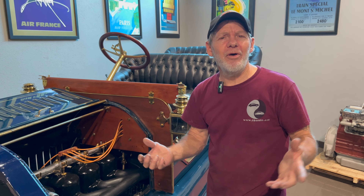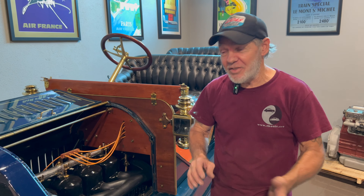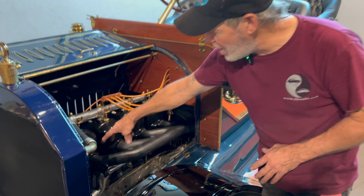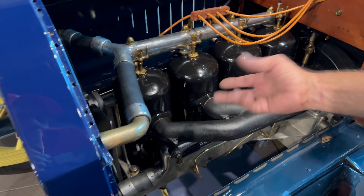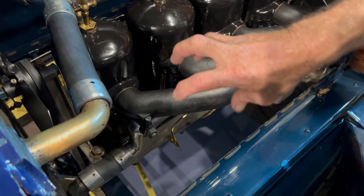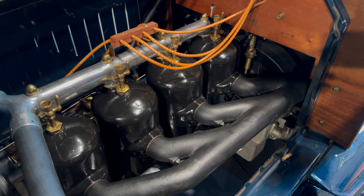The intake valve is at the bottom of the piston — it's not really a valve midway. You might think a two-stroke has a reed valve, but this doesn't. There are ports inside the jugs, and as those ports open up and fuel is delivered, the rings draw the charge up into the cylinder. It's just two-stroke: up, down, that's all it does.